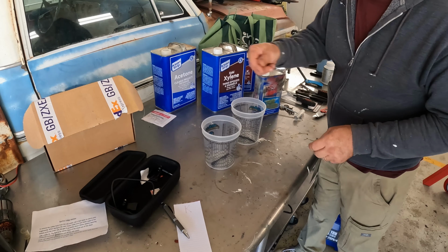If you're using this tool, another little secret is don't let the blade touch the glass. You want to cut closer to the body. Really take your time going around the corner. And if you reach a point like this where you're not leveraging very well, pull the knife out, start from another direction.